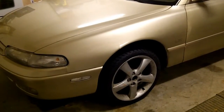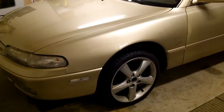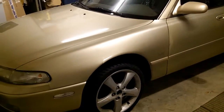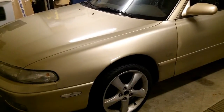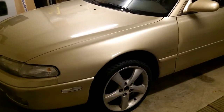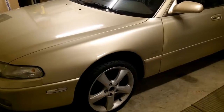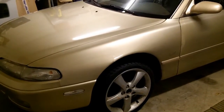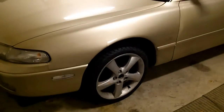Those are the Mazda 6 wheels with 215/40/17 tires. The tires I'm using are actually Primewells and they do not rub. The drive home was excellent. Other than my obvious lower control arm and tie rod issues, the tires handled awesome. I already checked back there, no rubbing. Can turn freely, no problems.